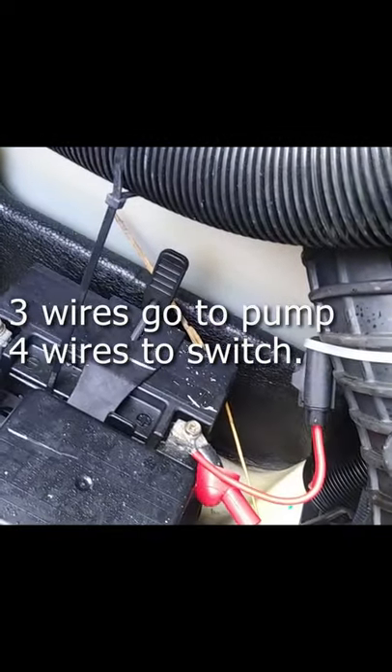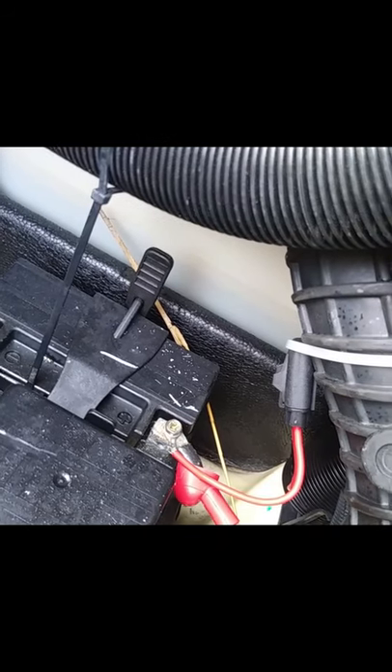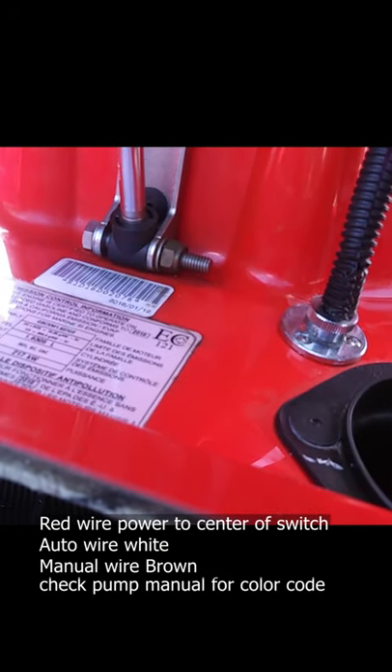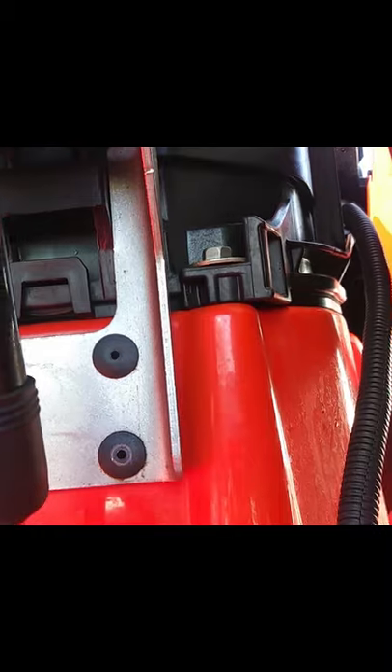We wire-tie the fuse around the air inlet, then that red wire goes up with the other two wires in the three-conductor that went back to the bilge pump. It comes through a cable gland that's sealed with silicone and squeezed down hard and screwed in. Then we put a split loom wire protector up. The wires come around the side and you drill two holes — one here and one here — to get the wire to come up.